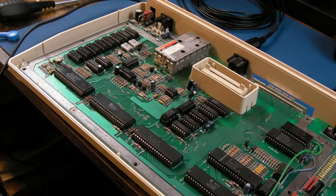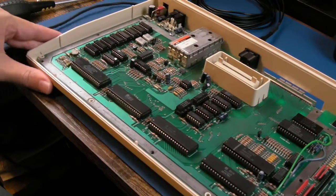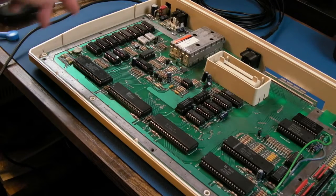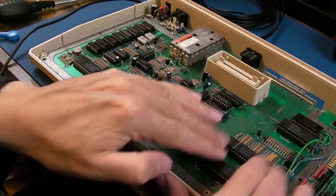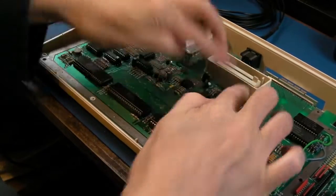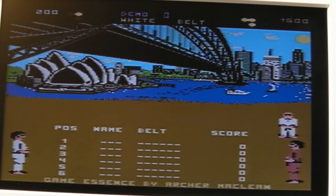Yeah, so the 2N3904 here, I might swap that, but before I do that, I'm just going to power this up again. We'll see if we can get the problems back and wait for them to go again and just scope the stuff here in relation to the colour signal. No chip creep there. Everything's pretty firmly in its sockets. Just for the several minutes it was off while I was taking the screws out, the colour's back, so yeah, it's super annoying. I'm going to need to wait for it to start glitching again, I think.